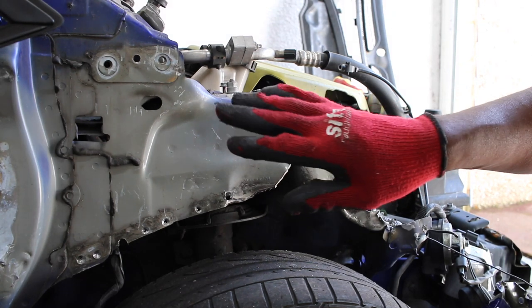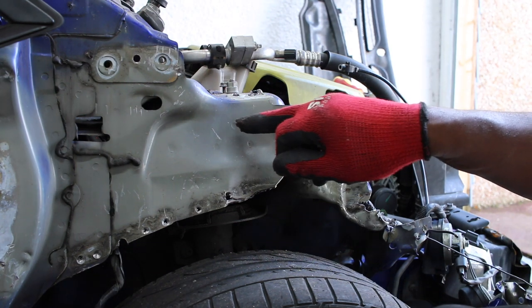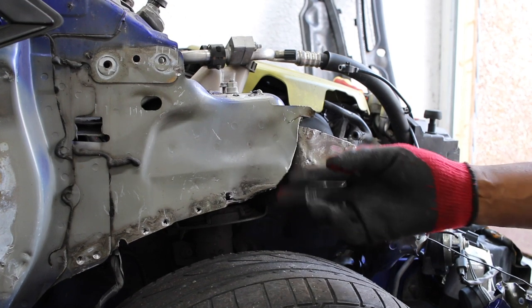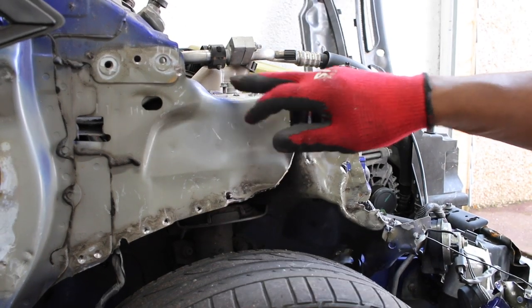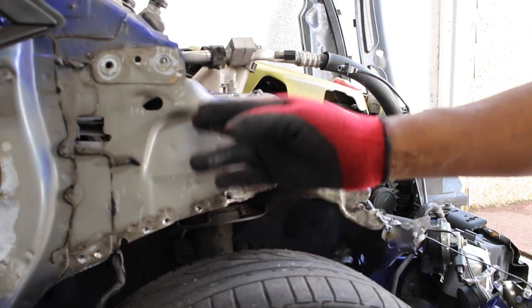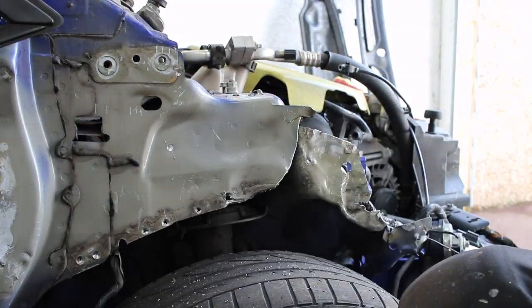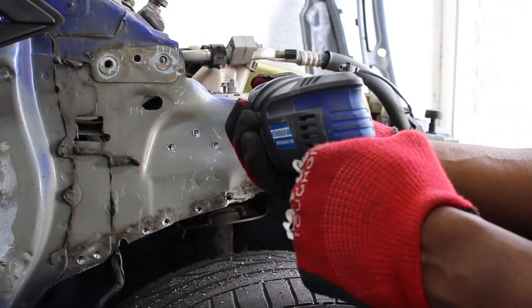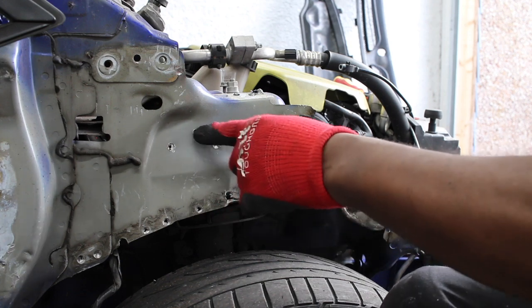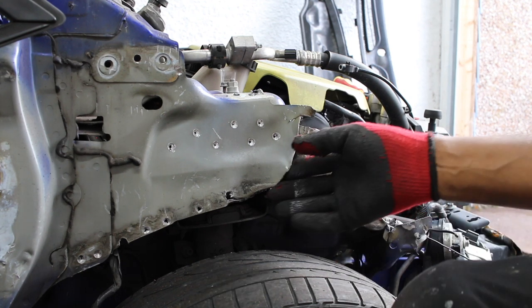It's time to drill. We've taken off that top level. What we're going to do now is drill out these little spot welds here — one, two, three, four, five, six, seven of them. Once we drill these out that should free up this underneath, which will allow me to take this piece off. Then we'll measure up first to make sure we're going to align it just right, and then we'll cut it somewhere along here.